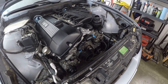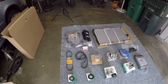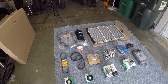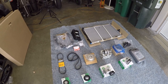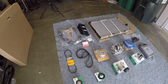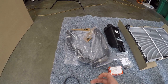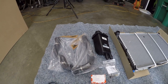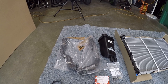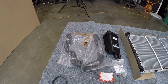There are a lot of parts that are going to get replaced in this job, so let's go see what we're looking at. This represents all of the things we're going to be replacing in this E39's cooling system. We're not going to be replacing absolutely everything — meaning every single hose — but we're going to be replacing the key components. First of all, we're going to be replacing the radiator hoses. These have plastic caps on either end, and while those caps make installation and disassembly really easy, they also become brittle over time, and especially these 90-degree angles can develop cracks and create a massive leak.